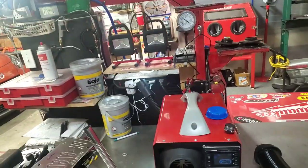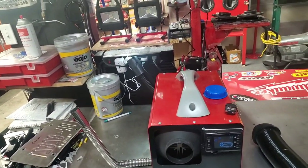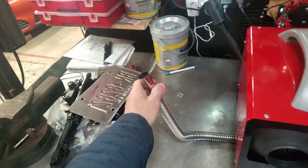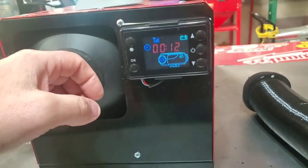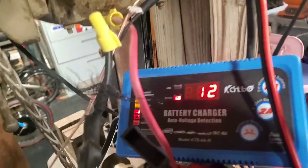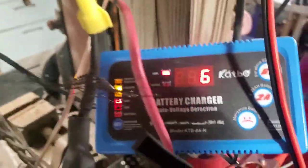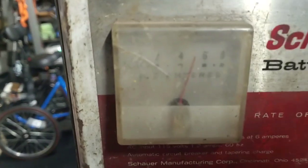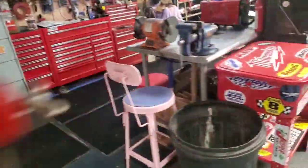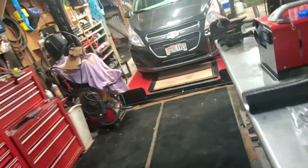This has happened to me before and I pretty much expected it. I like the lower horizontal style of this unit. The exhaust isn't even hot, so this one never even fired. It just shut off. Let me come over and check the charger — it's charging at 6 amps but the battery is still showing low. With both chargers going that should be enough power to at least get it through the igniter cycle.